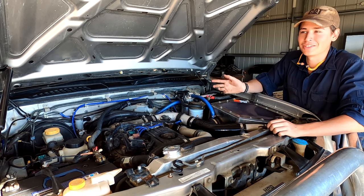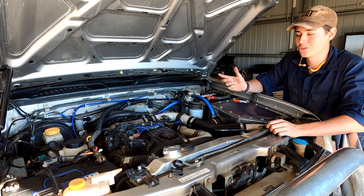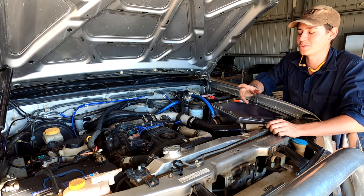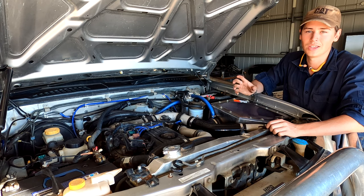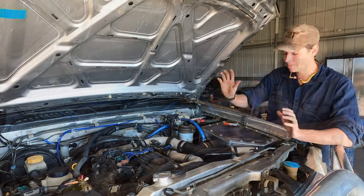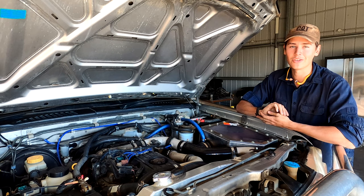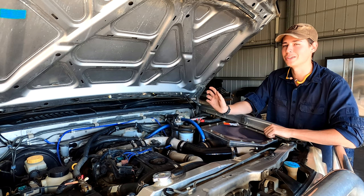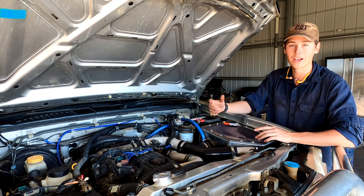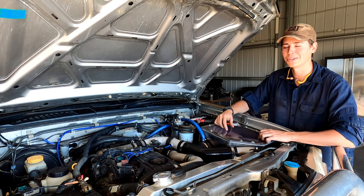An EGR block is about $5-$10 off eBay - it's just a little piece of plate that sits in there, or you can make them yourself. Just watch out: some modern vehicles have a sensor that can throw a code, so you might need to drill a small hole to let a little bit of gas through. While we're here, this is my airbox - I made it myself. An aftermarket airbox looks snazzy but isn't necessary. I changed the filter from a factory drum style to a K&N pod filter, which makes pretty cool turbo noises - bonus points.